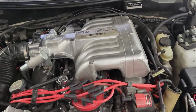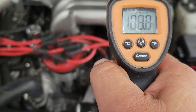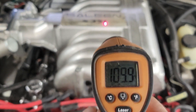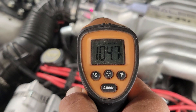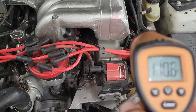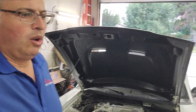Let's see what we have for a temperature. I just pulled it into the garage. We're reading 111 degrees Fahrenheit. Going right down the center: 112, 111, 109, 110, 111. As we get to the throttle body, that's where the air is obviously cooler — we're at 104. As we work our way down it goes up. Getting closer to the engine, we're at 120 right there, and down a little further: 126. That gives us a good baseline of what we can expect.